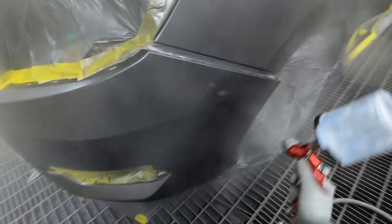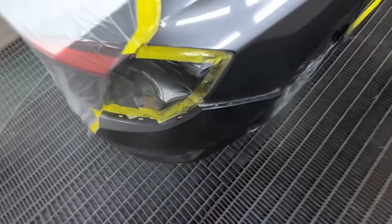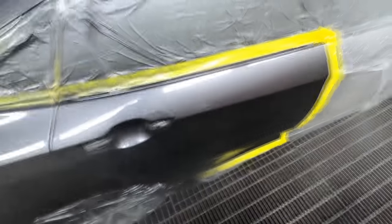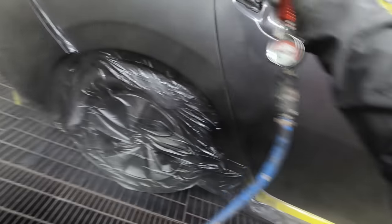We're doing the clear coat stage now. The clear coat I'm using is the PPG LBC 105 — it's one of the new generation clears and I'm a big fan. It's quite different from the normal clear coats I've used for most of my career; actually quite similar to the Standox Performance Pro clear. The first time I used it was fine, but after that I struggled a bit and got a couple of big hanging runs — it just wasn't working too well.